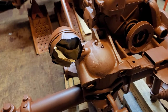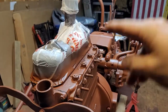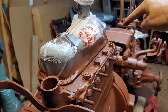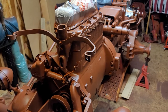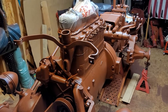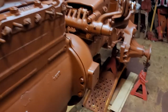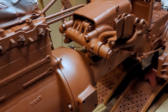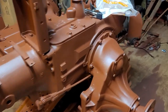That's about the best way to fix the grill because as bad as it is, I don't think there's much more I can do with it. The hood — somebody through the years, instead of pulling off the exhaust and everything, propped up this side of the hood and put a crease down the top. I'm going to try to get that crease out because I really don't want to spend money on a new hood. It's pretty flat for the most part, so I should be able to pound it out. I'm going to try to use as little Bondo as possible.